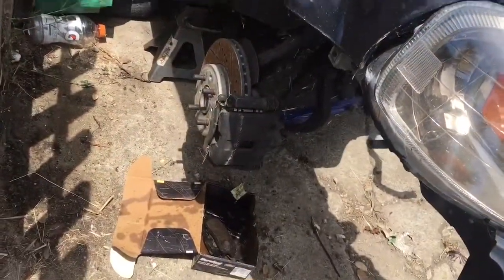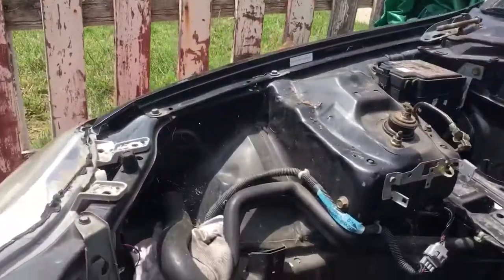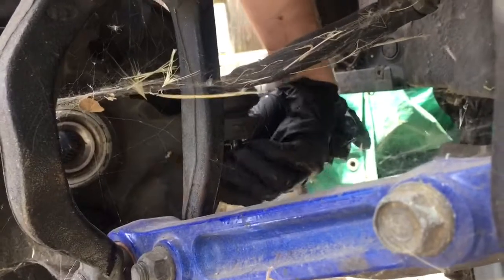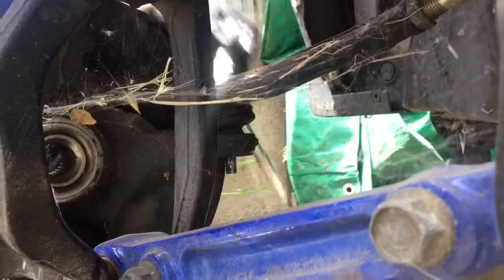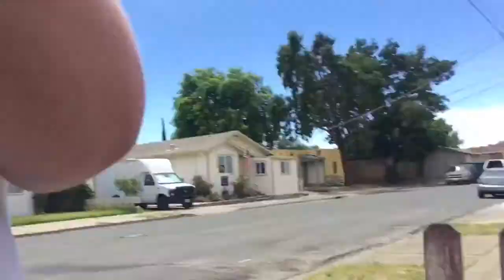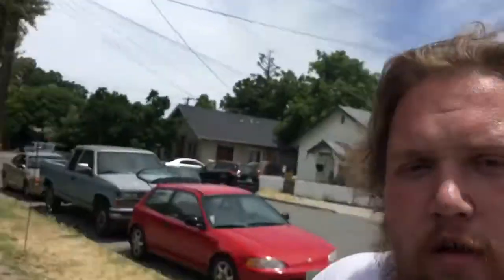We've got to get this passenger side out. Getting the tie rod out right there. I'm going to have to shimmy underneath it. Your boy doesn't exactly fit underneath the car next to the wall, so Chris is going to be Mr. Nice Guy again. We got the ball joint for the tie rod out. Now we're going to get the upper ball joint and the upper control arm, the compliance bushing, and the other bolt holding the LCA in — then the whole thing comes out.